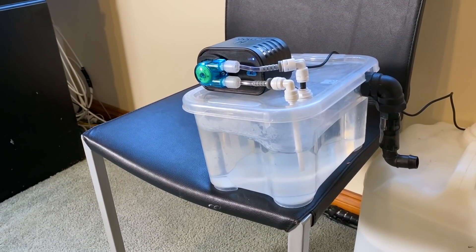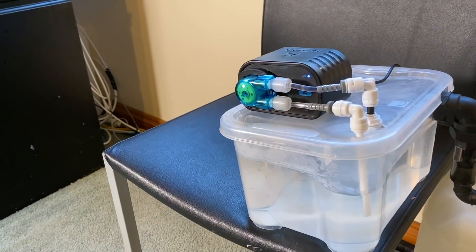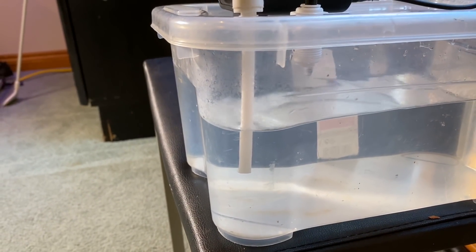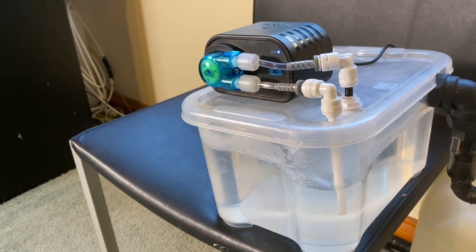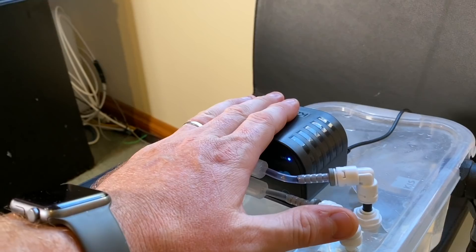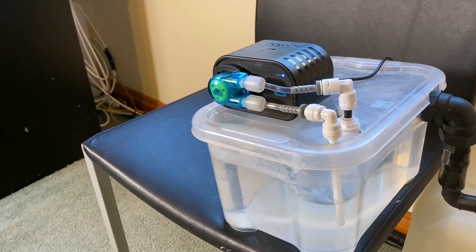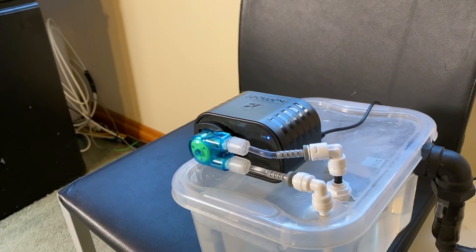It has been 10 days and I've caved. I was going to push for 14 but I've hit the 10-day mark and wanted to give you an update so I can wrap this video up. The unit is still operating nice and silently — the pump head's doing its job, it's not hot at all, and the drip rate looks about the same as before. Exactly what I'd recommend for a calcium reactor, Calcos, or even an automatic water change. The one thing I do want to point out though is that the body — and I'm assuming it's from the stepper motor — is quite warm. I can hold my hand on there and it's not going to burn me, and it definitely doesn't feel like it's going to melt the plastic, but it was something I was a little worried about. Stepper motors tend to get hot in continuous use, and this one definitely is warm. I don't know if that's going to be a problem in three months, six months, or 24 months, but after 10 days it's putting out a noticeable amount of heat.